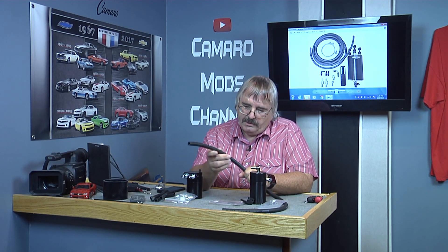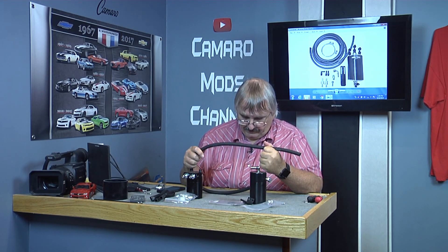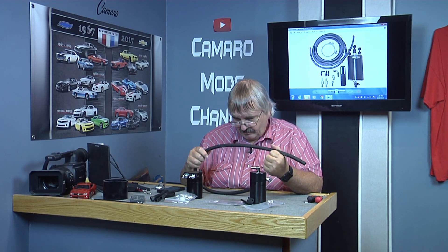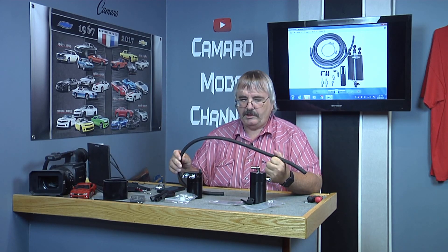So get some real hose like this — it's kind of like a gas line, made in the USA. I'm not sure if that says gas line on it. Yeah, fuel emissions. It's a 3/8 hose. I believe it's 9.5mm — yeah, 9.5mm.